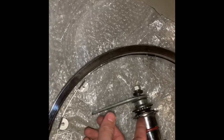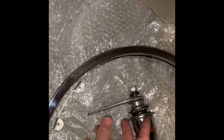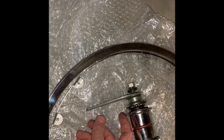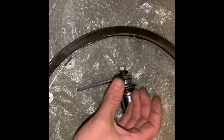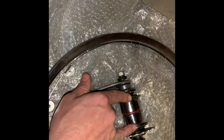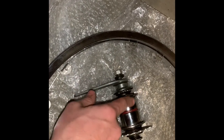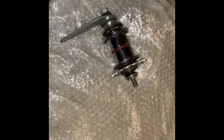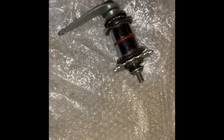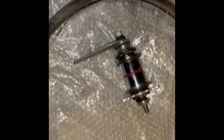What we also have to do is pound one of these flanges off, which we're just going to set in a vise and hit it — these just pop off. Then we have to align them perfectly so that all the holes are aligned. So that if you stick a spoke through, all the holes will be lined up. That's what we have to do to the hub.